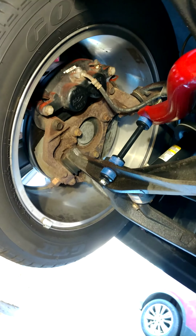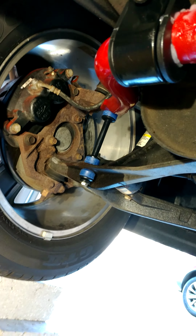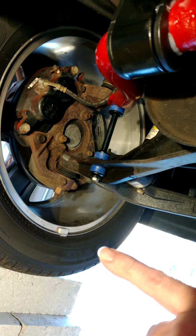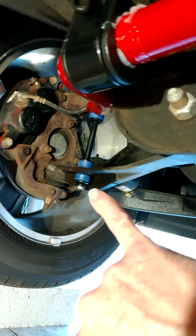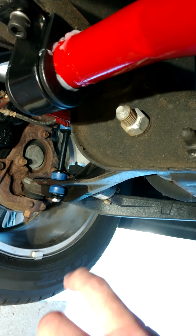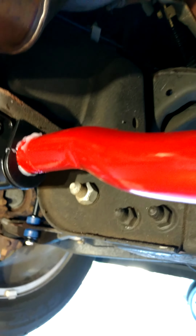And I got the grease on the bushings. I got the same thing over there, about a pinky on top of the bolt. So putting the 2 extra thick hardened washers down here at the bottom to shorten that bolt, instead of trying to cut the top of the bolt off or anything, worked really good.